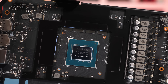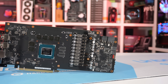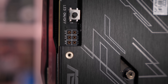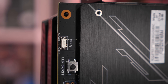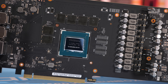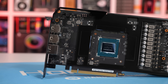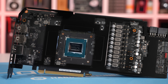As for the PCB, for an RTX 2060 this thing is massive, so there's plenty of spare room. The only noteworthy addition is an extra six pin power input — most models only feature a single eight pin connector, but this ASUS model gets an eight pin plus a six pin. There's also a dual BIOS switch that allows the fan profile to be adjusted from performance mode to quiet mode. For my testing I used performance mode, which is still exceptionally quiet. The quiet mode stops the fans from spinning entirely when the GPU drops below 55 degrees, while in performance mode the fans are always spinning but the operating volume is very low.